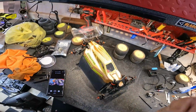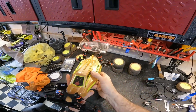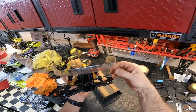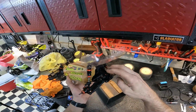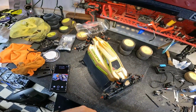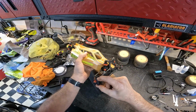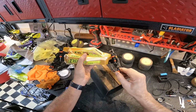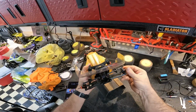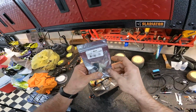So next thing we did was going to try. I tried laying the shocks down in the rear. I thought it would be a risk before he started making suggestions. You notice some of my diff is out of it right now, but I tried lowering the links, tried moving the shocks in. That didn't help. Chris has said, where have you got the front spindles? And I got them in the stock setting, which is a thicker one on the bottom and the thinner one on the top. But I didn't really make any changes to that. Other than that, it's pretty much stock setting. So I did use the ball diff, the gear diff, and liked it.